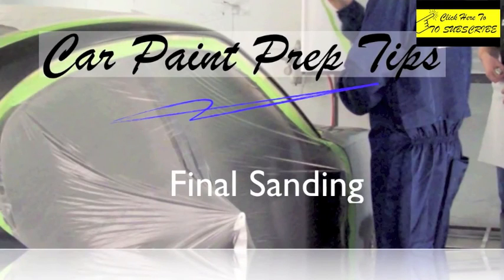Then once you've blocked, you're going to start final sanding. And again, final sanding, depending if the entire area is going to be painted or just clear coated, is going to determine the grit. But final sanding is the last step you do as far as sanding. And again, if you're going to be painting, like if you're painting an entire car, you're going to sand the entire car with 400 to 600. And make sure to get the edges good. Hard to get areas, use a red scuff pad.